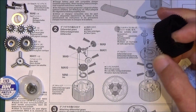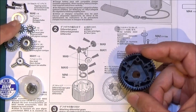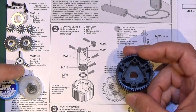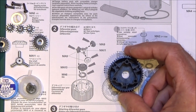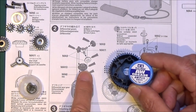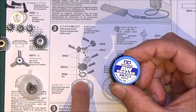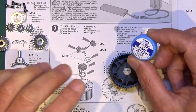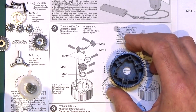It's exactly the same. You need your spur gear case and these parts listed on the left, which shows you all the parts you need for this step. I've got them all laid out ready to go — just match them up with the diagrams and you can't really go wrong. There's quite a bit of grease needed on these parts. You can use the grease that's supplied, but I've used the AW grease which is really sticky and tightens the diff up a little bit, giving a slight anti-slip effect — go with whichever suits you.